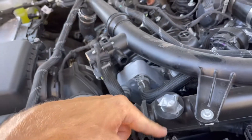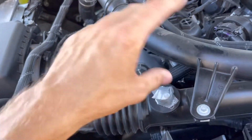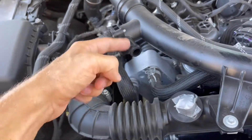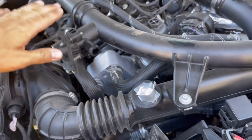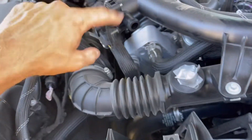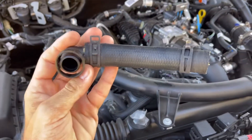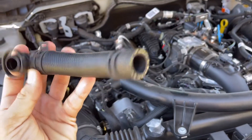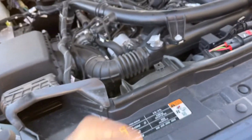And it usually would return into your airbox, right? So it's just recirculated. You don't need that air — it doesn't cost any performance or do anything like that. It's just a recirc so that the extra boost has somewhere to go whenever you're done and you don't want any more boost — instead of over-boosting, it just releases out of this back into the thing. So now you'll hear it like a blow-off valve. Simple as that. And if I ever want to put it back to stock, it's literally probably less than a five-minute thing — less than five minutes to get this off.